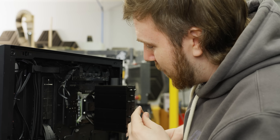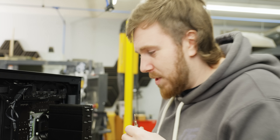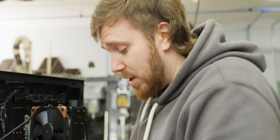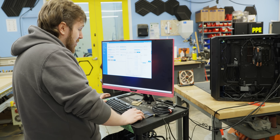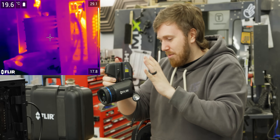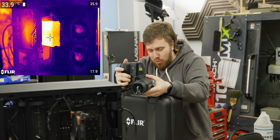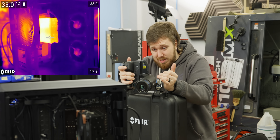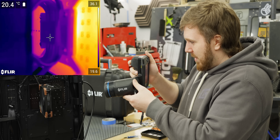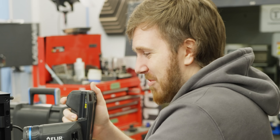Let's boot. Justin did all the hard work honestly. Looking at it right now, we're still looking fine — not better, not worse. When we look through the thermal camera, we can see that our front CPU cooler is much, much warmer overall than our back CPU cooler, which implies it's moving away a lot more heat — as expected. But the base of our back CPU cooler is at 20 degrees, so it doesn't seem like it's doing much at all.